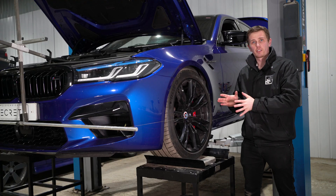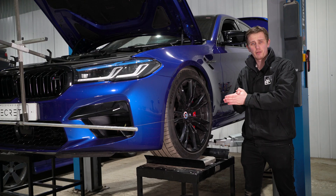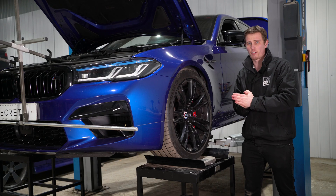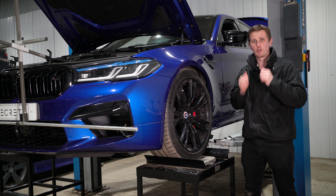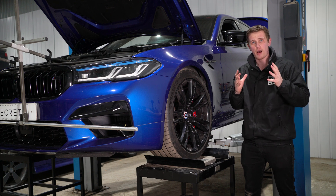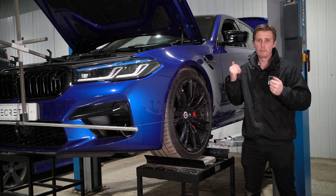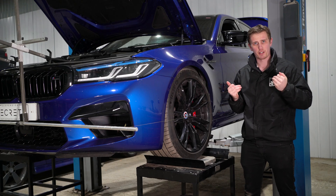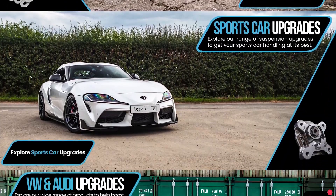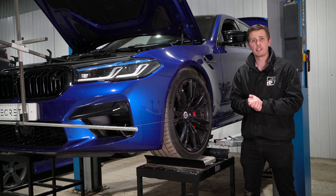The parts have now all been installed to the M5 and the car's been fully set up with a fast road geometry alignment. With the camber bushes fitted up front we've managed to gain an additional 0.9 degrees of camber, which is really nice for fast road driving to carry speed on the B roads and reduce understeer massively. With the rear toe arms fitted we've been able to dial in that geometry and we know those settings are not going to move when the car is pushing hard — it's going to feel absolutely planted with much more stability and traction. If you want to see what parts we do for your car then head over to the website where we've got loads of articles on recommended upgrades and tuning tips as well as the shop, and we'll see you next time.